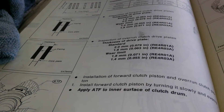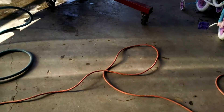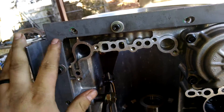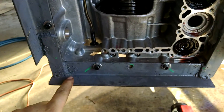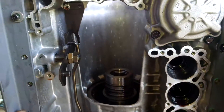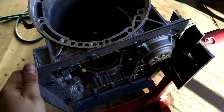There are plenty of videos on a full step-by-step, but if you get a book and take your time, cleanliness is the most important thing. I made a little housing adapter — just crudely welded angle iron with quarter-inch rolled steel and drilled holes — that mounts the casing to an engine stand. That way you have a nice jig to hold your casing while assembling everything. It's much simpler to put everything in when it's standing up, and it can rotate for valve body work.